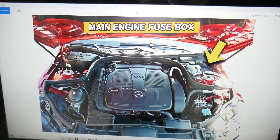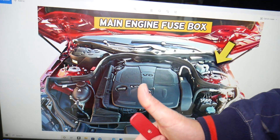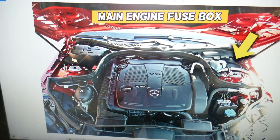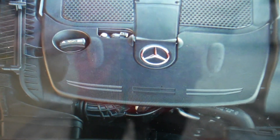One line will be hot and one will be warm. But if your air conditioner works on one side and not the other, usually the problem is not the AC itself — it's not the compressor, not the pressure switch or anything like that. It could be something really simple. But before we continue, let's explain why it's always a good idea to test fuses and relays.